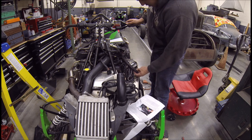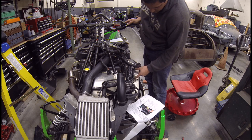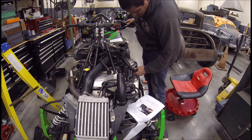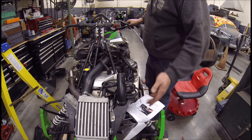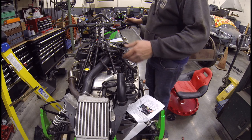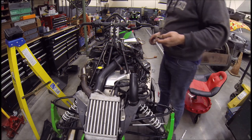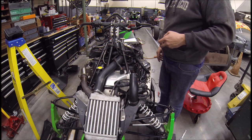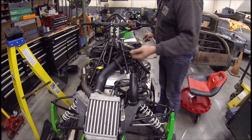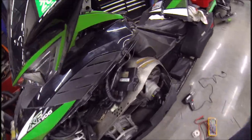That's really it — plug this back in and hook up the knock light. I'm not going to zip tie all that in because when I've got to pull the hood off to change the oil I'd be unzip-tying it every single time. We'll see how it works out. I checked out a bunch of spots and it seems like this has got a really good ground on it — really low resistance. We're going to go with it right there. Easy to get to. That'll be it. We got it installed and zip tied in.